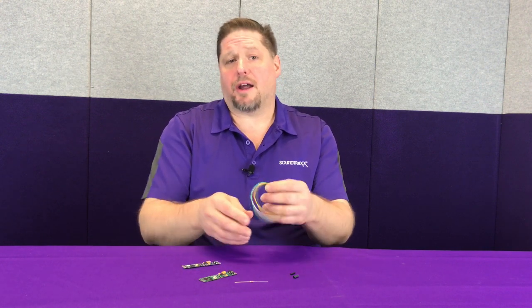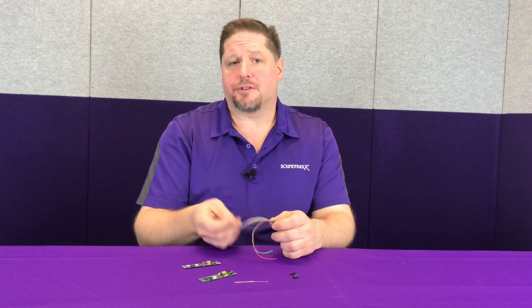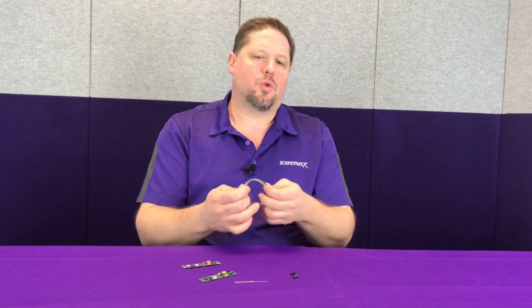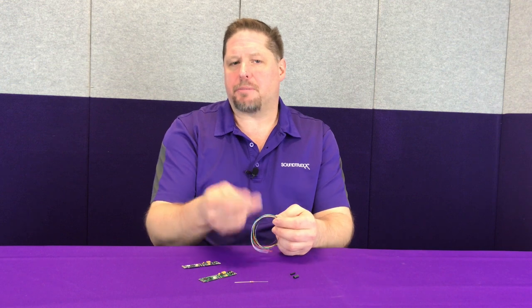Once we get our wire identified, the white wire, the yellow wire, the brown wire, the green wire, and so forth, are actually the negative lead to your lights. When you're adding in your 12-volt or 14-volt light bulb, you just simply hook up between the blue and the white wire for your headlight, for example, and it'll work just fine.